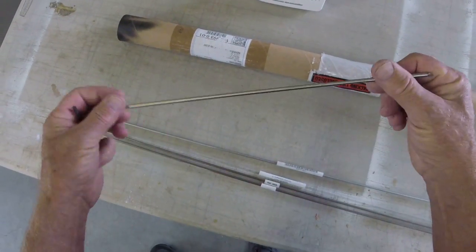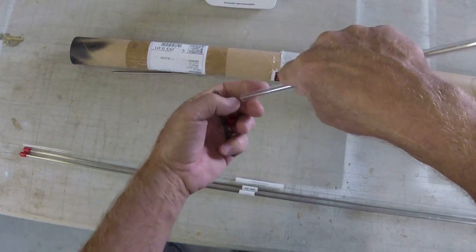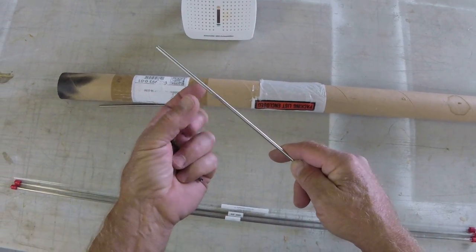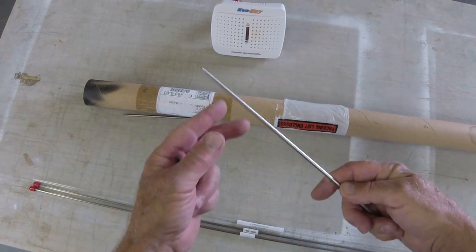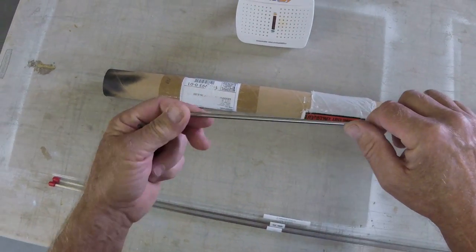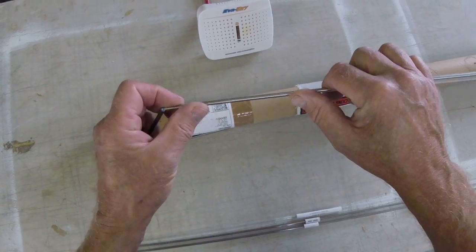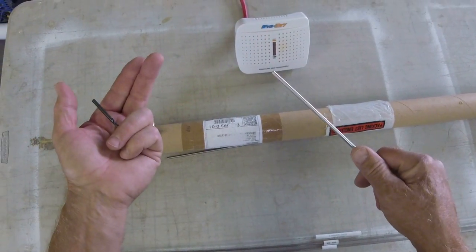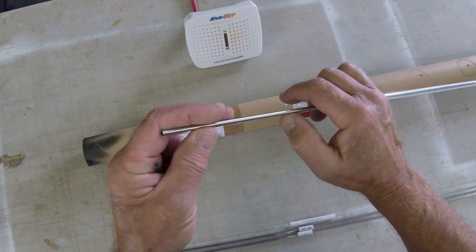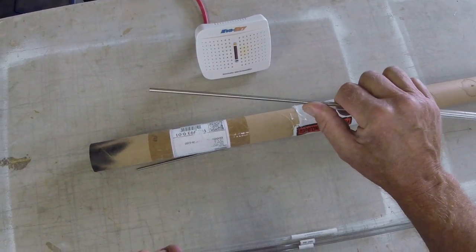This is the tubing that I use to make my fuel tubing. Yeah, I know, it's a little heavier than the brass stuff, but I don't know if you ever noticed, that brownish, soft, yellowy brass. It's brass, right? The tubing that they give you with fuel tanks, the nitro eventually causes it to get brittle and it can break. I bend my own stainless tubing.